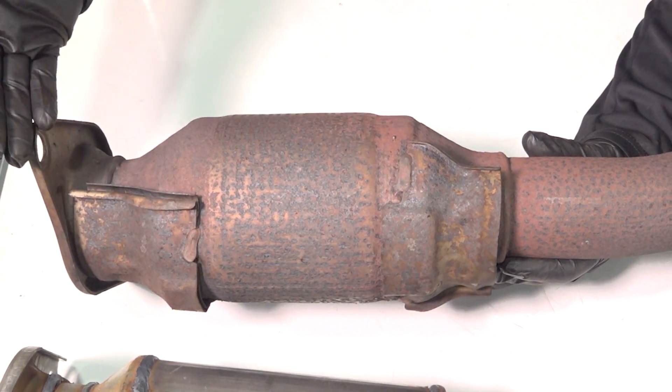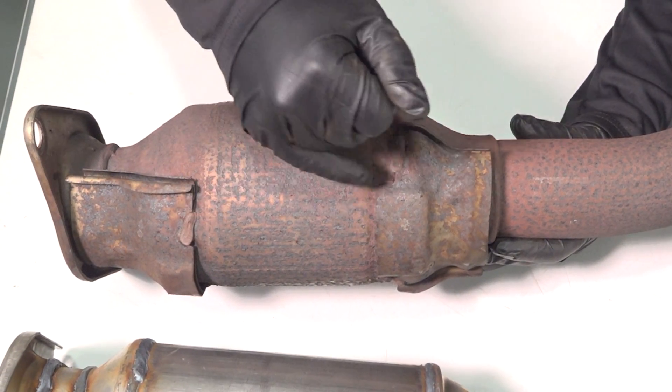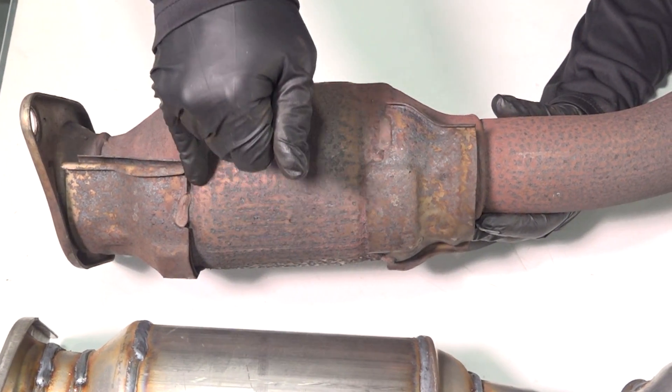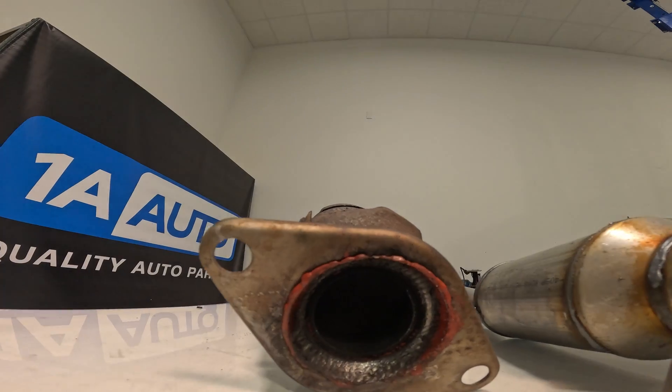This is the way it came — like two or three welded shields. I don't understand; maybe they thought these were weak points for heat, or because it's facing down they don't want you parking on a field. But it caused a weakness right here. Anytime you weld on stainless steel you're going to have a weakness, and right there is the weakness.